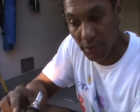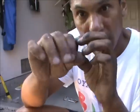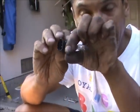It took me about maybe 30 minutes to get that light bulb back in. So unless you know what you're doing, you can drop the bumper. It'll probably be a lot easier. And what I learned was, in the light bulb, this is the old one, it has three little tabs. One of them is bigger than the other. So when you're messing around in there, you have to make sure that the top one, this one here, is the bigger one. When you're putting the light bulb in, I was putting it in sideways, kind of like this, and I was there for a while.